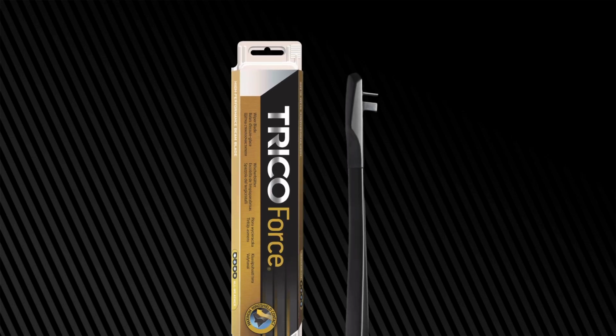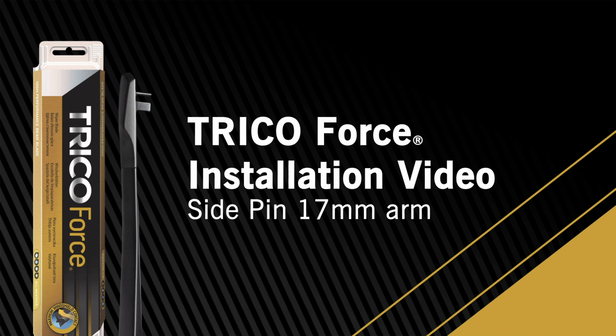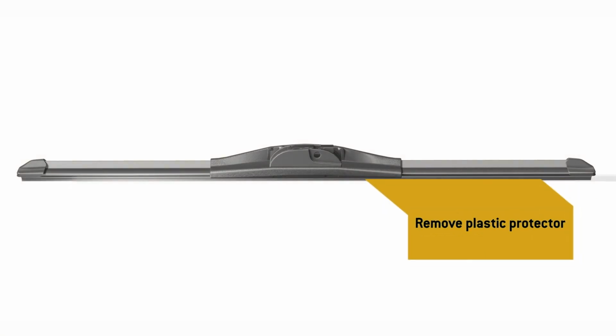You bought a Trico force wiper blade. Now what? This video will show you how to properly install the Trico force wiper blade onto a 17mm side pin arm. Before installation, remove the plastic protector from the blade rubber.